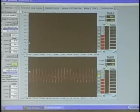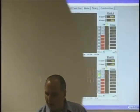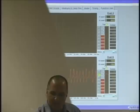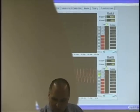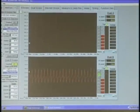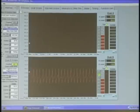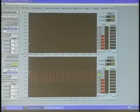Now, everyone with the meter, what do you notice? The meter is reading 1.2 volts, right? Would you be able to tell with the meter if you had a bad tone ring or reluctor? No. If we had something that spins around like this, with little teeth on it, going past a little magnetic setup with a couple of wires, you would not know that this little tooth over here is too small, giving us a signal that is shorter. The meter only averages. That's the problem with a meter. Not fast enough. This is sampling at about 1 to 3,000 samples a second. Most scopes are about 20 to 25 million samples a second.